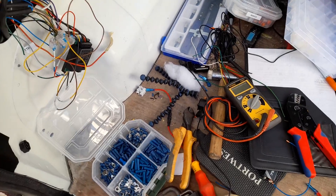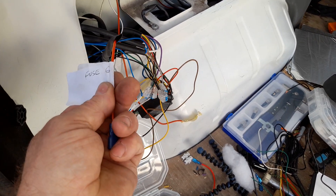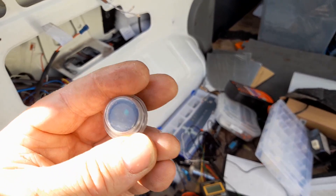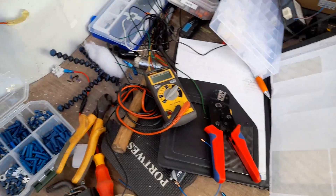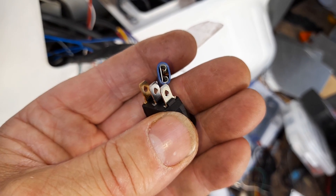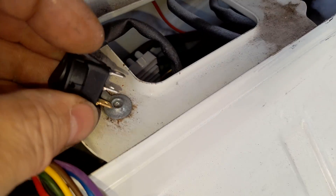Because these are permanent feeds, technically one of those pins down there can be permanently connected. I've put an insulated female Lucar terminal on the end of this cable - which is fuse number six at the front in the dashboard - and this is going to go into my switch, which I haven't cut a hole for yet. I've just put a waterproof top over it - it's just a switch but it's an illuminated switch. You'll notice there are two silver tabs and one brass tab; the brass one is your ground to make the little light work.